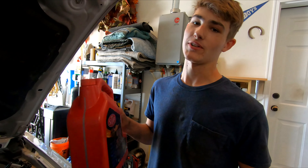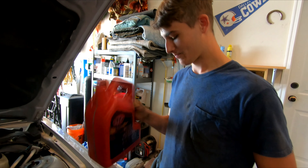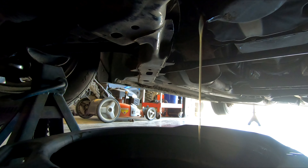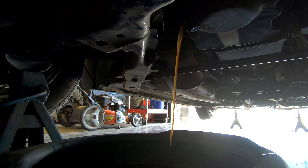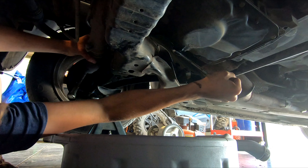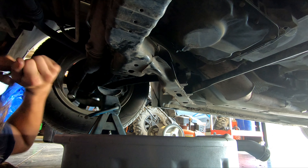Give the bottle a little shake — it's like chocolate milk, you want to shake it up because this has been sitting in my trunk for two years. You're gonna want to flush it. Looking pretty clean. Slide the drain plug back in — you don't want to tighten it too much, just enough to where you know it's not going to rattle out.